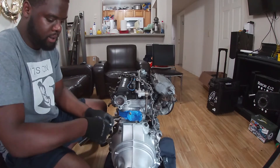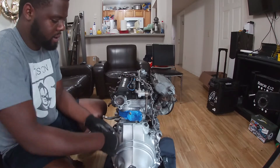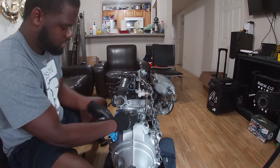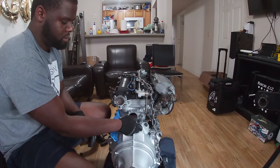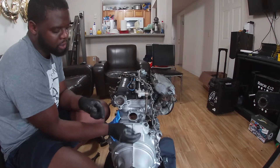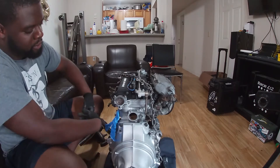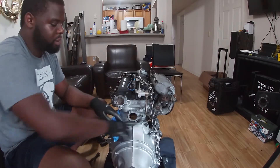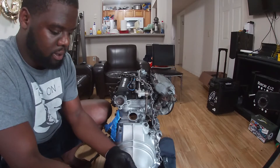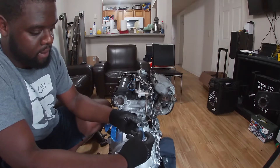So for the rear neck, we're going to do the same thing. We've got our gasket here, we've got our neck and this bit right here. So let's pull this tape off and get our bolts out. If you are running a coolant reroute, this is the time when you put your thermostat in there and then get your larger thermostat cover with your output to your heater core and your motor, or whatever you're doing with your special setup. There are a lot of different ways to do this, but I'm just going to keep it simple and go with the stock parts — no reroute until we can afford one.